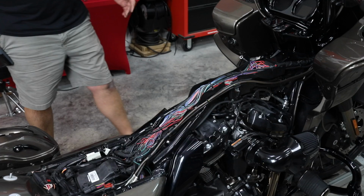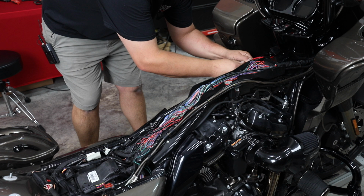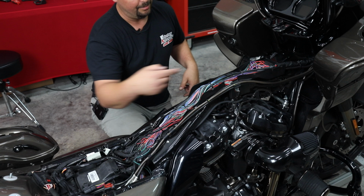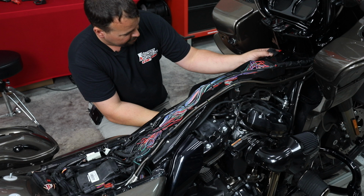All right. So I've got our wire kind of pulled out here, and I just did this the hard way. I would advise you to do it the easy way. So you run the wire from that side to this way, but with this big fuse holder on it, you could just unplug it from the amp, feed it through before you put your amp in. I would say it's going to be easier on you, but I always like doing things the hard way.